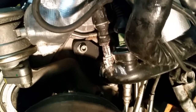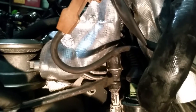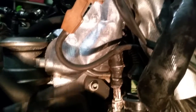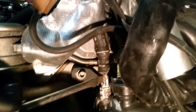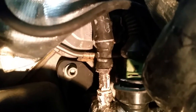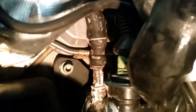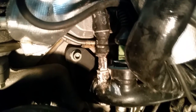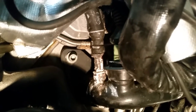So here we are with a close up. I had to snap off the hose clamp that was on here. I basically bent the heck out of it to break it off because I couldn't move it up since this is so ballooned out, and the hose is so brittle and smushed I couldn't even move the hose clamp down. This gives you a better view showing just how out of shape or ballooned that hose really is. If you have the engine out, check and inspect these things because it wasn't easy to get that hose clamp off - I couldn't imagine doing this in the car.